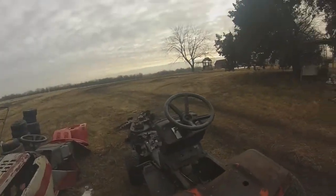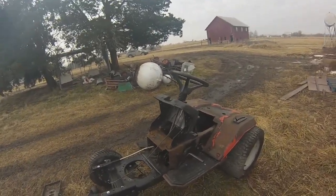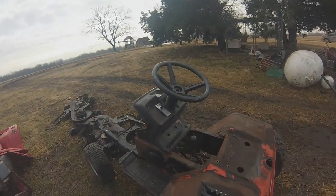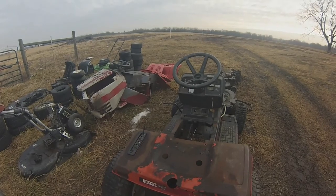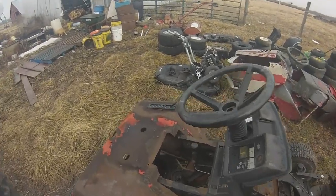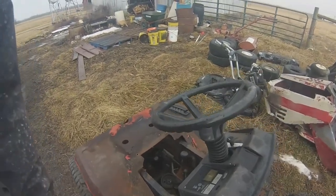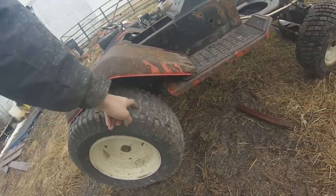This is an MTD I had in a few videos back. What I'm going to do is I have some buddies that want to use my motor and stuff, but I really don't trust them with my five-speeds because they're not easy on the shifter and sometimes can't get it at the higher speeds, so I'm going to build this one for them to use. I'm just going to get rid of the dual pulley system — since it has a forward and reverse transmission it'll just have like 12 miles an hour all the time. I'm going to lock the rear end and double-cut the rear tires and remove every other tread line so it'll be better.